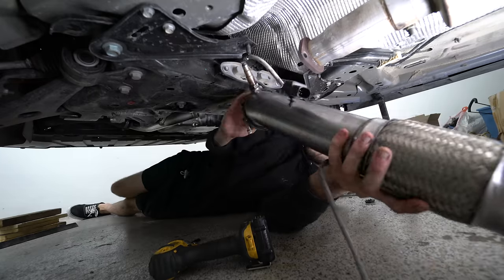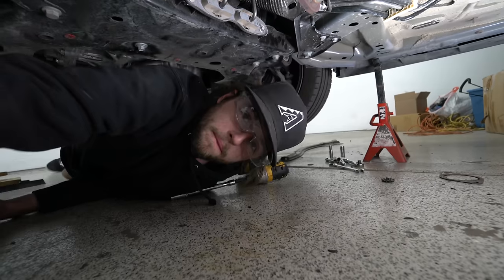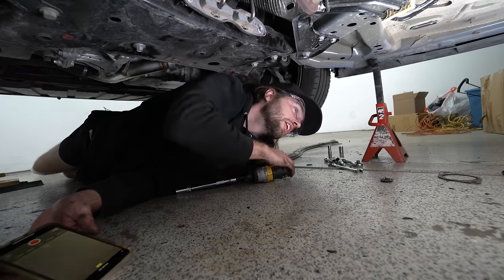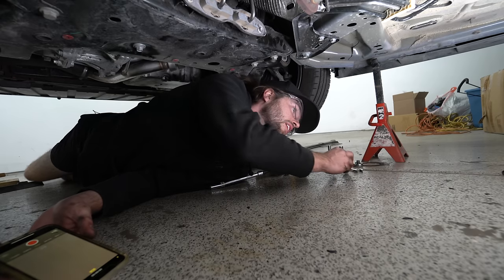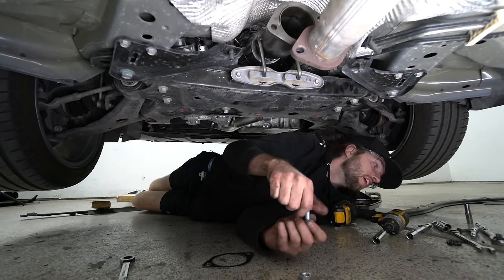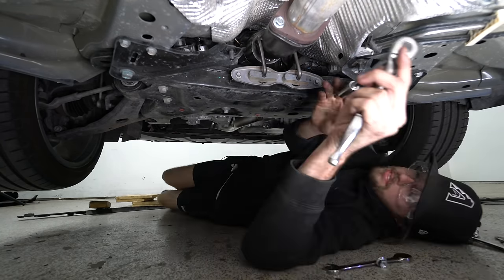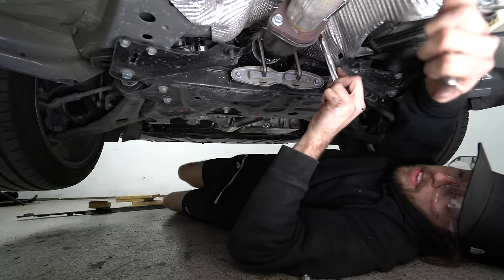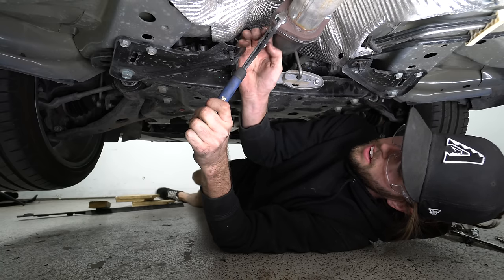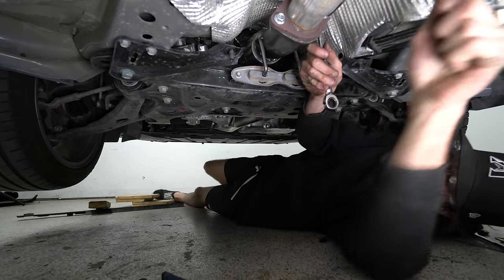Let's put the V-band on. Both clips are back in, both are plugged in. Going to hook up the cat-back with the new bolts and gasket — the new bolts are both 15mm on both sides, so I've got my 15mm wrench. I'm really enjoying this home stretch. I'd rather work on cars with friends but doing this myself, I'm rather shocked.